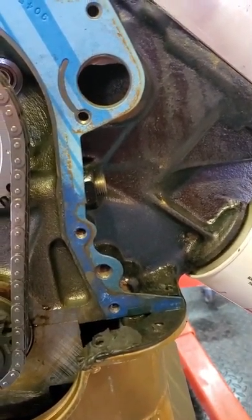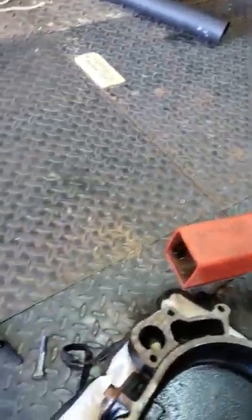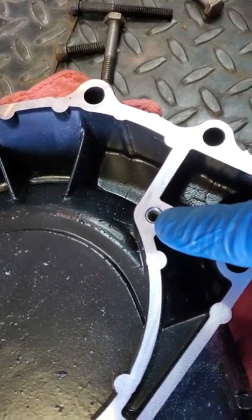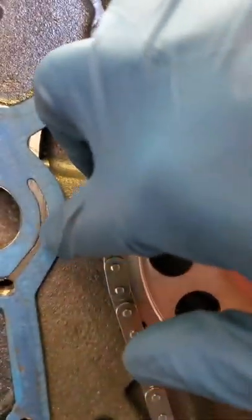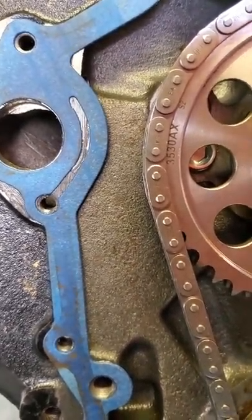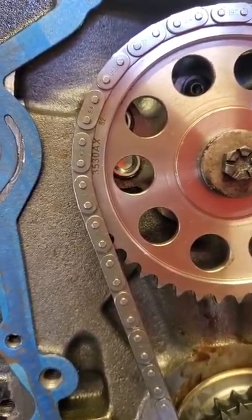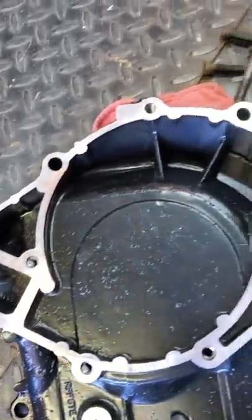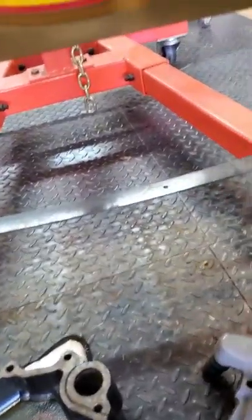Here's the motor. As I kind of thought, that third mounting hole on the automotive timing chain cover is not a pass-through into the block — these are the two that go through. That other hole would be somewhere in here. I know it didn't go into the block; I'm thinking it's just for mounting the water pump and provides better surface area and torque dispersion of pressure for sealing purposes. I'm just curious as to why the OE pump didn't have that.